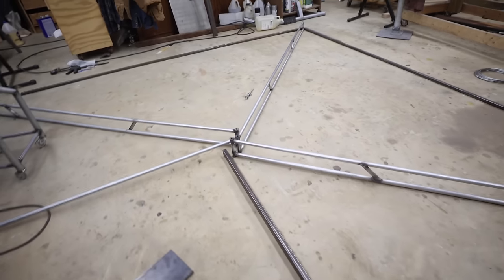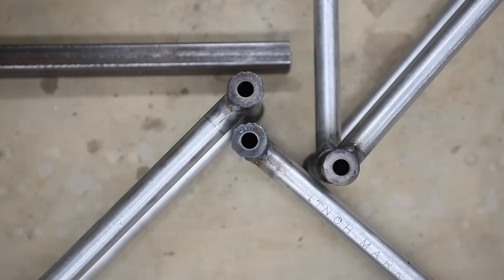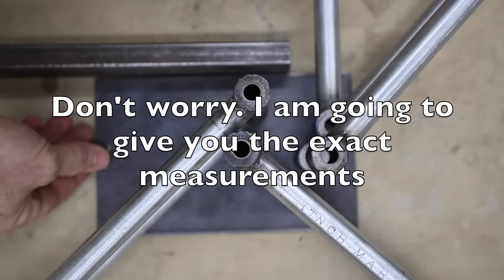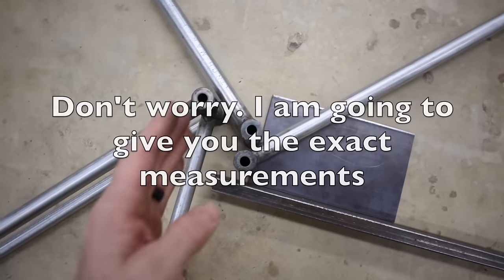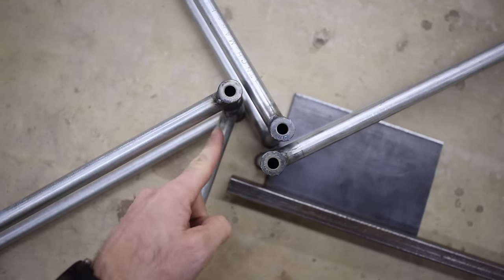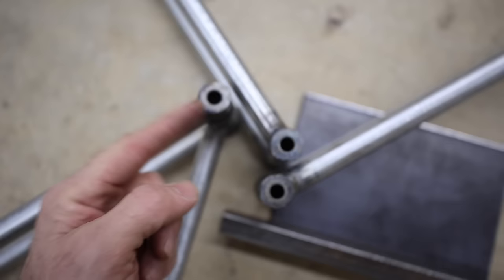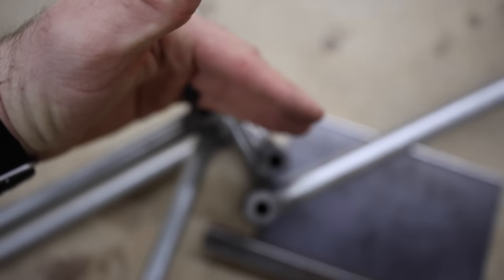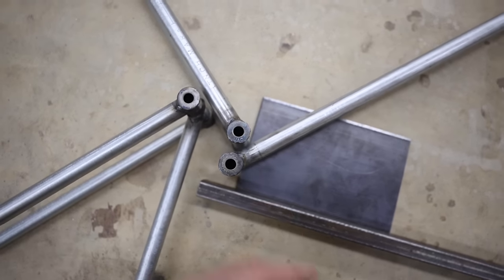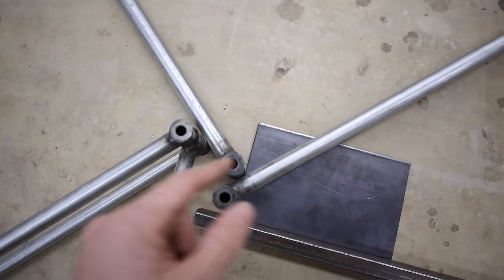I brought the mock-up inside the shop because I was running out of light. We're going to take the five-by-eight flat bar and slide it underneath all the assembled arms so we can mark the hole locations. We want it far enough out so that when it opens, it clears the body of the awning, and far enough in so that when it closes, the arms don't hit each other. Let me mark it out, then close it up to make sure those marks still work out.